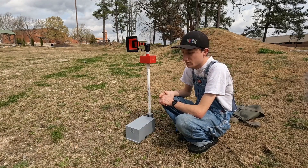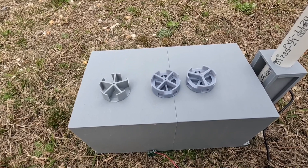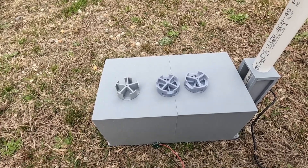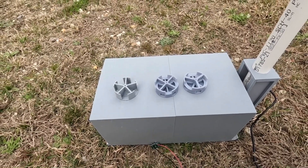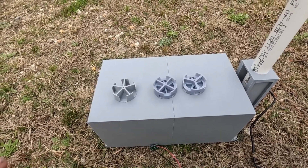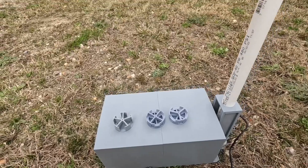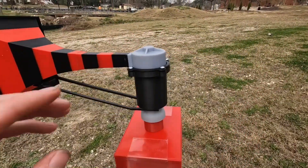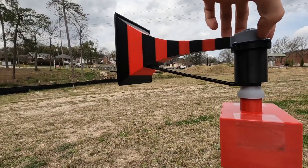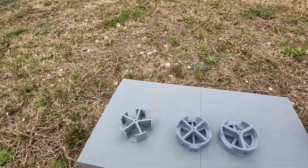I'm going to grab the camera and show you some of the more interesting things about it. One of the things we can start off with, as I had discussed in a previous video, is that the Thunderbolt 1000x can actually be rotor swapped — and it's not something you have to order from me when I first bring them out. This is something you can actually do yourself if you own the model. You pretty much just remove these four screws on the top and the one screw underneath holding the horn support, and the whole stator cap and projector comes off.